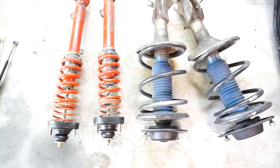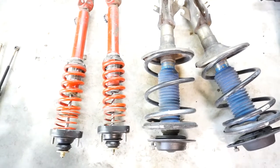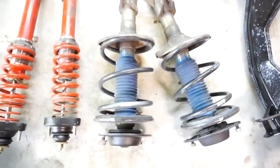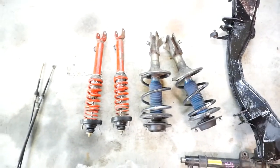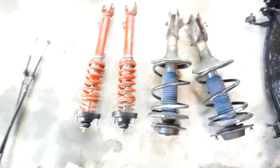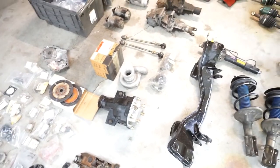As I mentioned, the Evo has been updated to Evo 8 style suspension, and the front end in the last iteration is more Evo 6 style. These struts fit that last iteration — these are Ohlins adjustable, these are GABs. This is actually a pretty great set of spare suspension, especially for New England hill climb. You could probably still win on this. It's good to have — if you send the RSSPs out for service you can still use the car, or at an event if you damage something you can swap in these knowing it's not junk and finish the event.